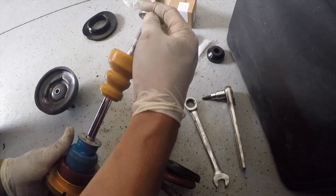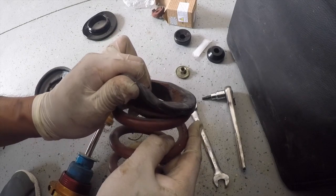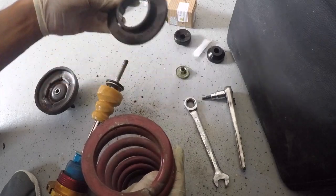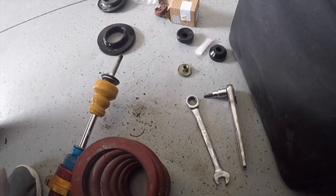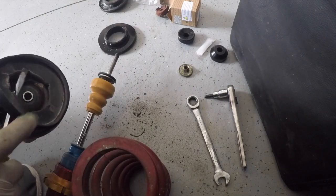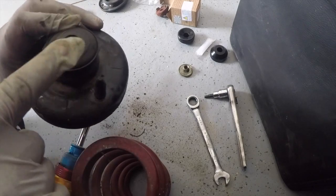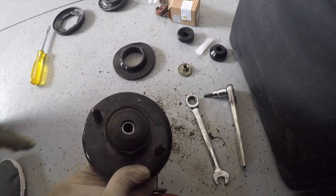You put this guy back in like so. I got to replace this — I got a new one here. The OEM one was in there and I gotta take that out. Okay, this is out. This new one is supposed to go in here, but I gotta take out these bushings and replace them with the Energy Suspension ones. See the sleeve in the middle? I gotta take that sleeve out.